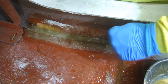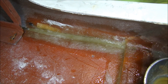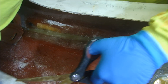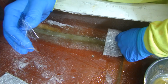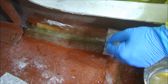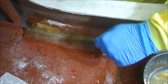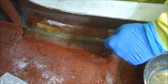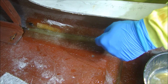Once the cloth is completely saturated, start putting in the matting for strength. Overlap the joint to make sure it's strong, slowly working in the mat. Push it in to make sure it's completely saturated. Too much resin and you'll just puddle it up — it'll sit there in a big chunk. Work in steps, filling it in. I also need to provide strength by putting some pieces across the seam — have your scissors handy so you can cut your matting to smaller pieces as you go. If the resin starts to get really thick — no longer liquidy, starting to get gummy — stop, because it's starting to cure and it will no longer stick or be strong.